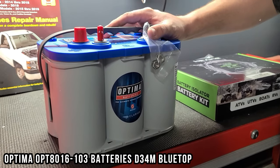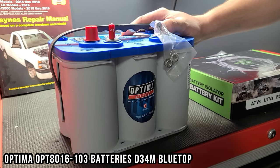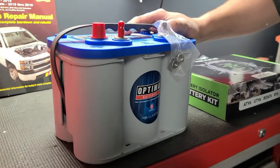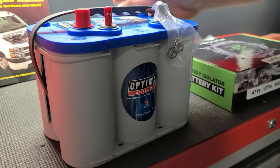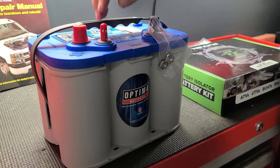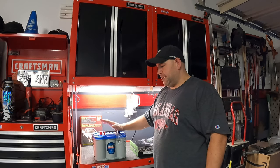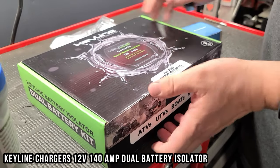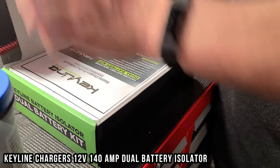For the first part of the kit is the auxiliary battery. We went with the Optima Blue Top battery. Some people like Optima, some people don't — we've had really good luck with them. Our starter battery is currently a Yellow Top. The reason we went with the Blue Top is because it's got extra terminals. Later down the road we're going to install the S-POD, which is a junction box for all the other components, making it easier to wire up things that need constant battery power.